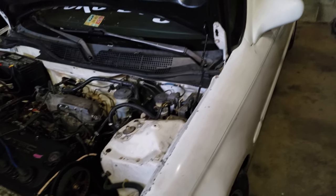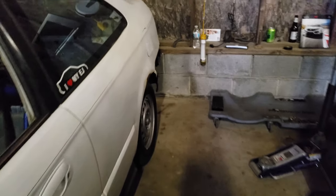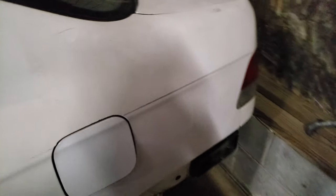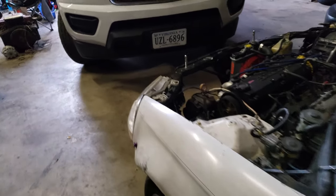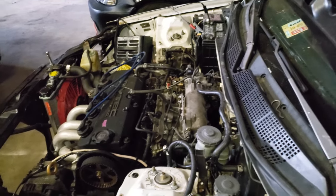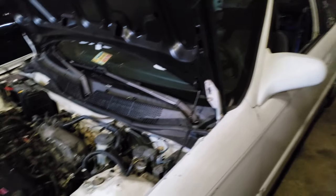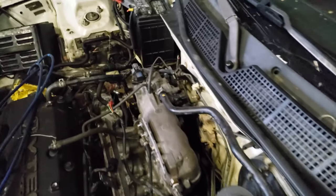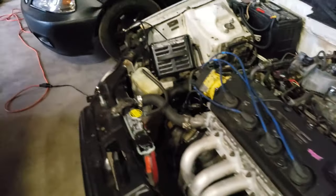I've also been playing around with fuel. Last event I mixed some E85 with premium — I think it was about a gallon of E85 and two gallons of premium. Honestly, I feel like it actually did something, though maybe it's just in my head. With the tune I had to give it a lot more fuel than it was running before. I want to go full E85 over the winter — do the fuel lines and fix the fuel line setup I have going on. Maybe pull the pistons out and do K-series pistons in it, go with higher compression, get a little extra horsepower out of it.